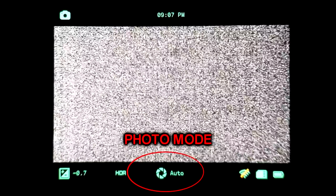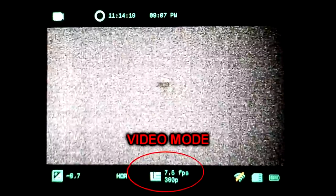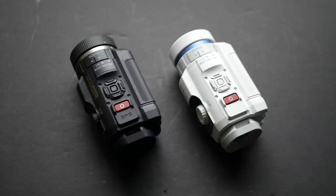The other setting that makes a small difference, but not very much, is resolution. These cameras can be set to either 1280x720 or 640x360. The sensor is capable of generating a 720p image, and running it in half resolution doesn't really allow it to process any more light. If you see any increase in brightness at all, it's because the image is an average of the pixels on the sensor. Something important to keep in mind: when you have these in photo mode, you cannot change the resolution or frame rate — photo mode always runs the viewfinder at 60 Hz in 720p. In video mode, you can change both settings and the viewfinder will reflect those choices.